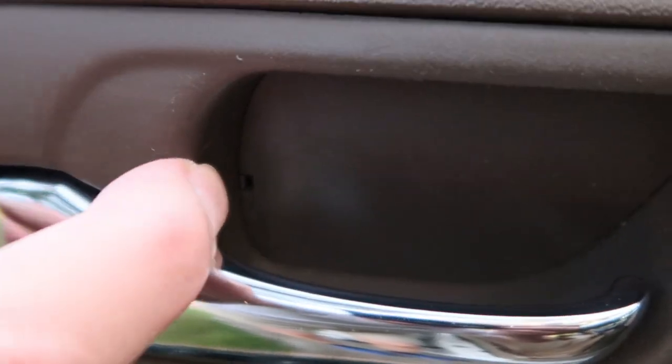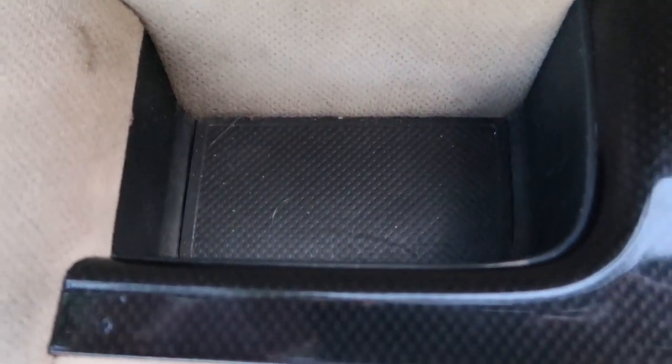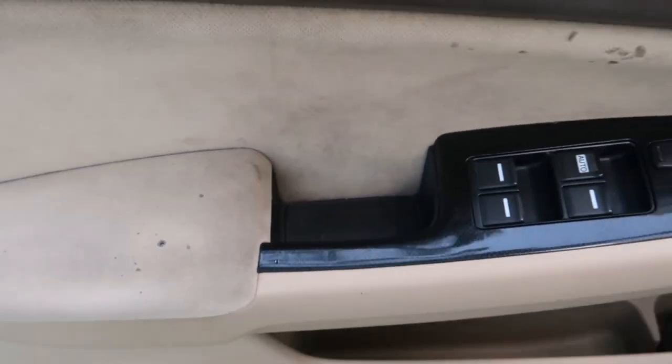You can see that little tab right there, and we would depress that tab. That little piece of plastic slips out and it reveals a couple Phillips screws. And down underneath this little plastic shield right here, there's another Phillips screw. Once we remove those three Phillips screws, we can work on the push pins that go around the door panel.